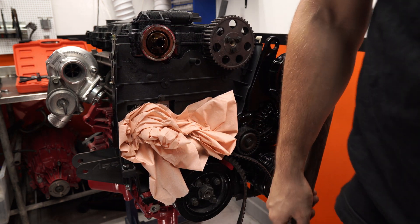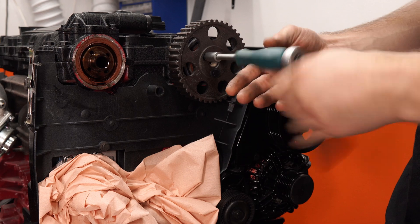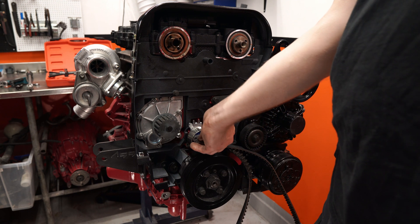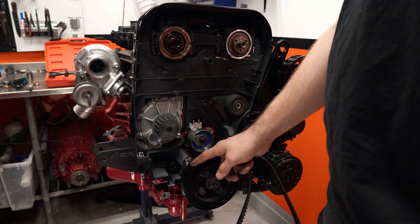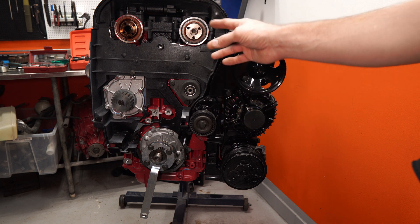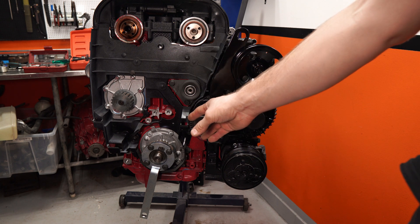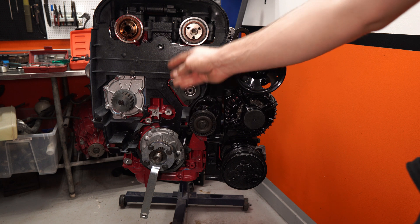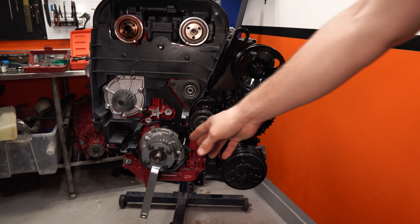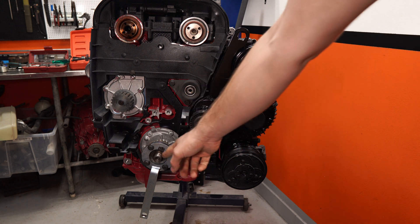It's quite on there. Now we're going to remove the intake side of the pulley. I'm going to go ahead and take all of this off - the tensioner and the pulley itself - just to make sure we start from zero. It's day two now. I had to go inside, charge all the batteries, it got kind of late. Taking off everything now: the tensioner, the harmonic balancer - the thing on the crankshaft. I put this special tool in to hold the crank so it doesn't turn when getting this nut off.